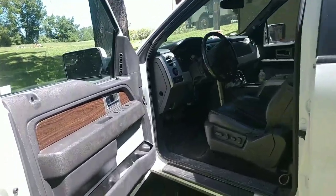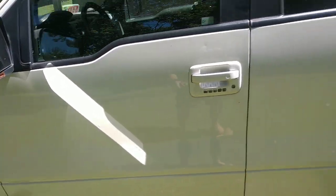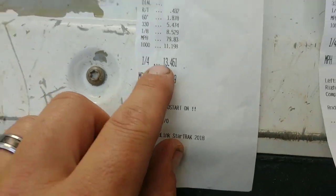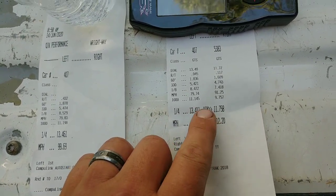More power tuning custom E30 tune in a 2013 F-150 — it's missing the EcoBoost badge but it's a 3.5 EcoBoost. Tune only. You're gonna have to take my word for it, but the first go around I ran the truck bone stock and it ran a best time of 15.01. The only thing I did different this summer was tune only, and my best of the day was 13.41 — over a second and a half improvement, tune only. That right there makes blending the fuel worth it.